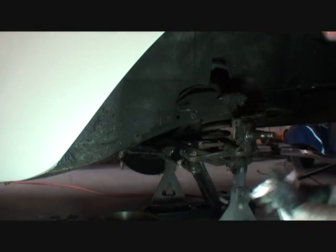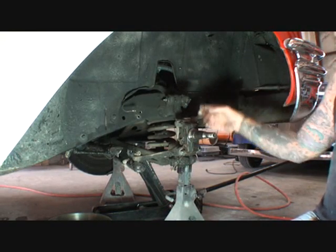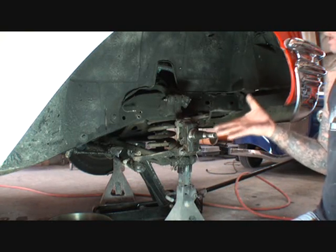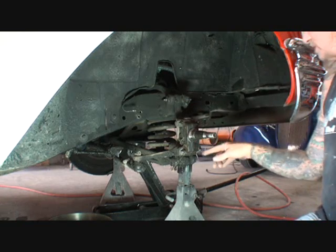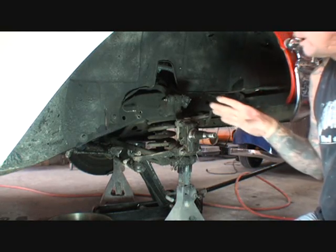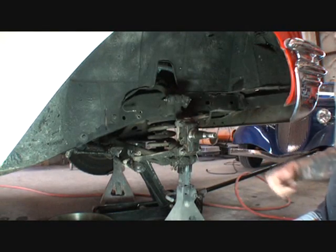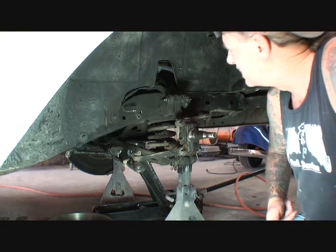This is a kingpin front end — it's got a kingpin that runs through it with bushings. As I was moving it around with my rubber gloves on, I noticed that it was still tight, so that's good. Always inspect to make sure that all your joints are nice and tight. I think what the owner of the vehicle is complaining about is that the springs and the shocks are weak. I can see that the shocks are pretty old.